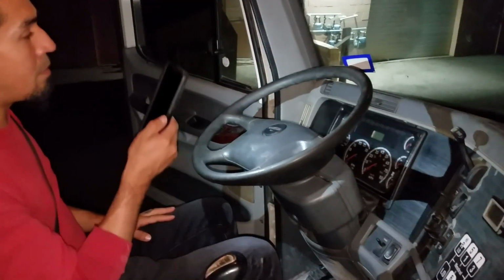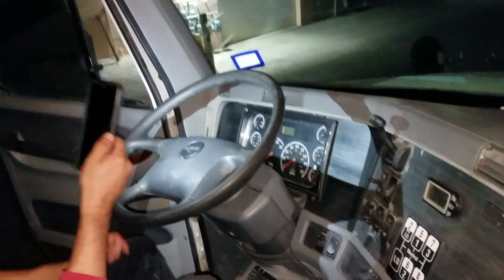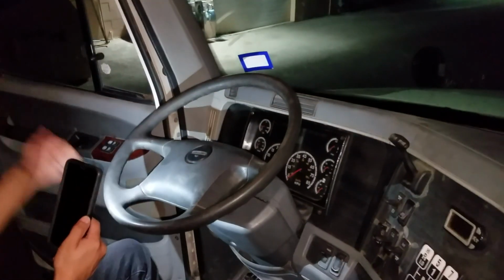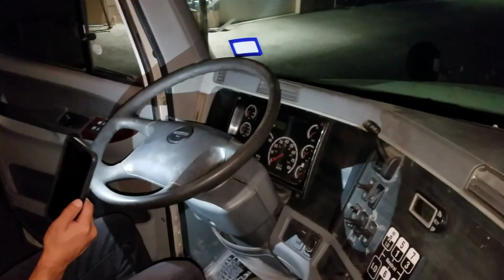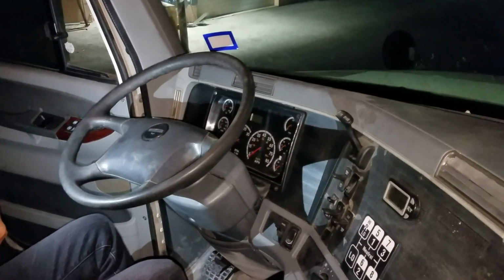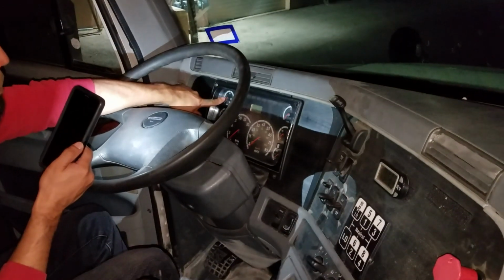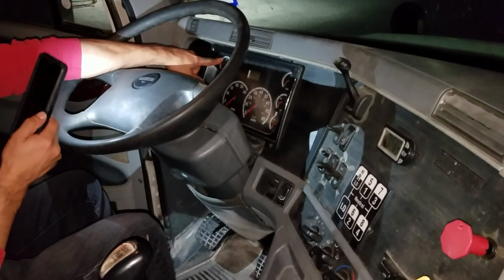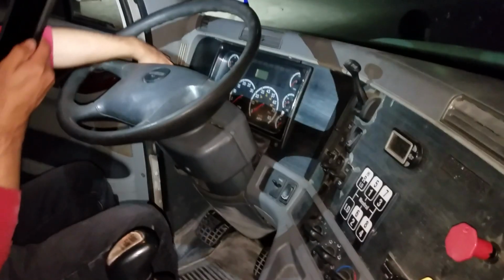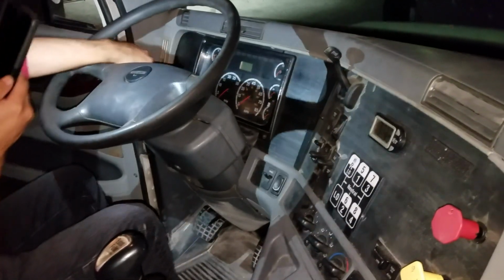And then now I'm gonna start by checking the left side of my panel and make my way up to the right side. I'm gonna start by checking my utility light in good working condition. One function went on in case I need to work on my glad hands or my battery box. Now I'm gonna start with checking my oil pressure. Normally it would be at 45 to 50 psi, good condition. Now my water temperature is gonna be at 180 Fahrenheit, good condition.